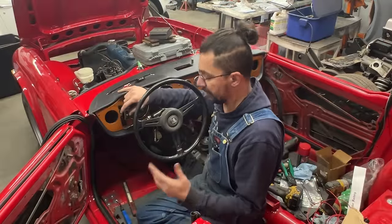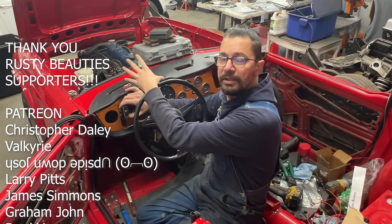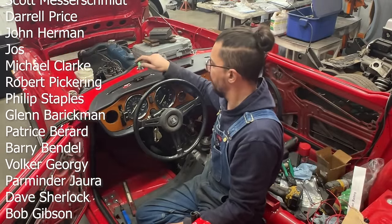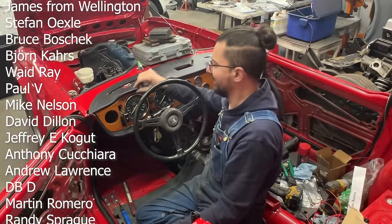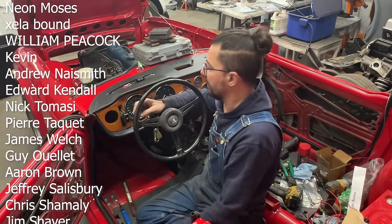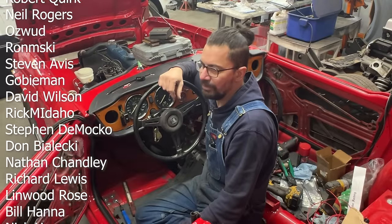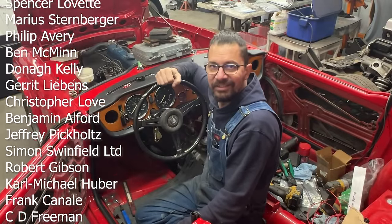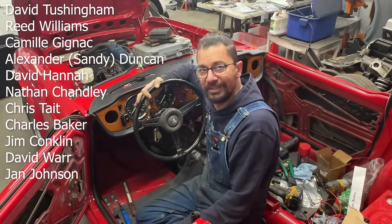In conclusion, just in a nutshell: the motor in the early TR6s — except the TR250, which is one speed — early TR6s have a two-speed motor, but because of the way the switch works, only one of the speeds is utilized. However, just by replacing the switch from the old style to this Lucas style — $80 — you can utilize your second speed as well, unless you have a TR250 which only has one speed anyway. With that, I think we should put an end to this video. When I start dealing with wiring it's like puzzles — I love chasing the gremlins in these old cars. Thanks for watching, commenting, subscribing, sharing, and supporting the channel. I'll see you in the next one, bye.